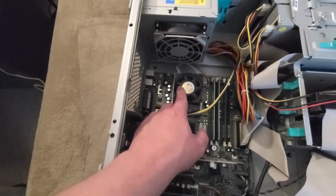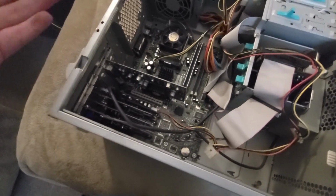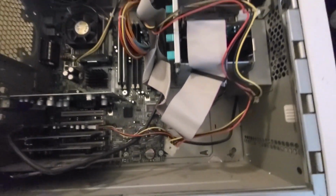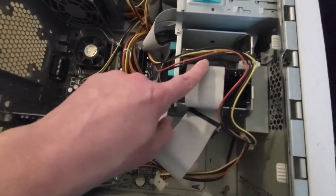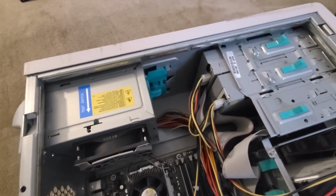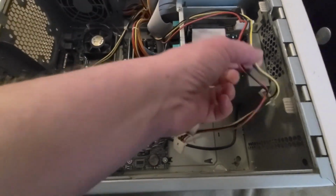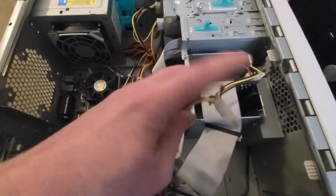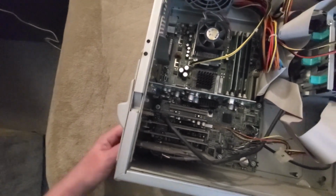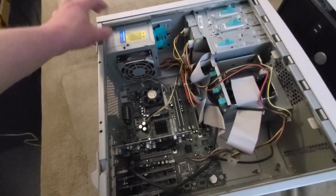As you can see, the CPU, everything in here was pretty bad. It was dusty, dusty spider webs, and a bunch of dead spiders in here. But it does have the hard drive in it. The 2 drives you can see on the outside, these are IDE drives. This is IDE, so this is probably going to be the 80 gig hard drive. Power supply's old, all just Molex. And obviously, what is this plug in? So that's a card. Okay. So everything looks to be intact on this.